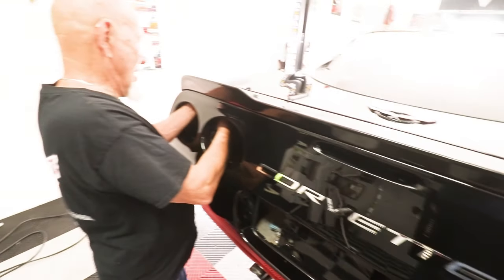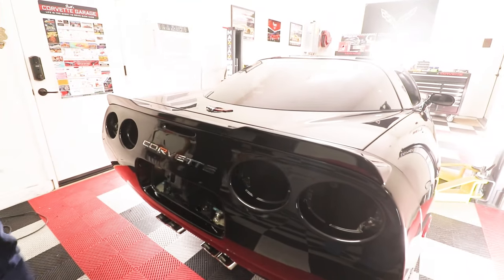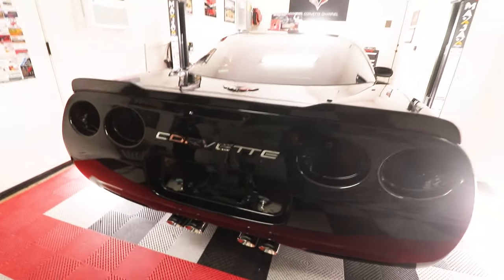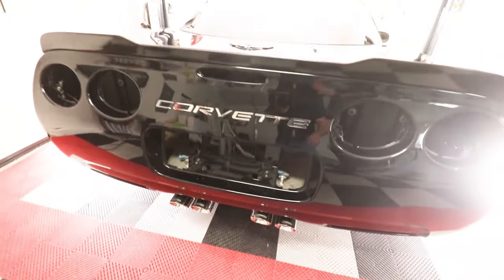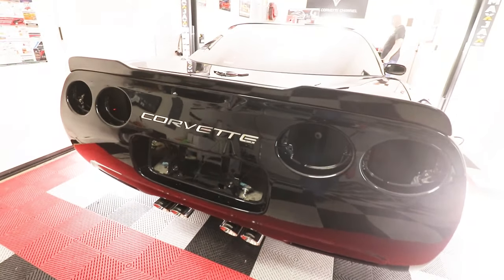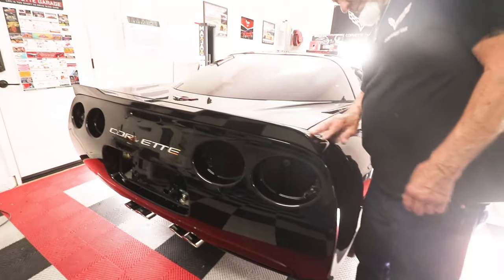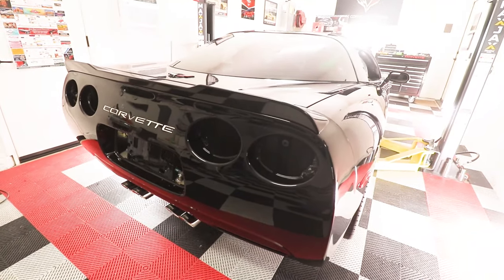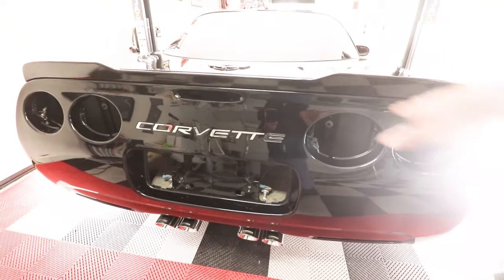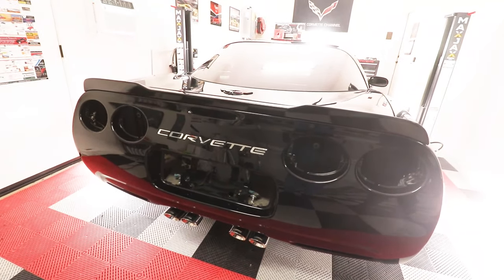Terry's just about done tightening that up and that is pretty much it for the spoiler. Literally all you're doing - the reason that bottom piece was out is because I had just done a ceramic coating on this car. It's a silver package with a five-year warranty. You don't actually have to pull the bottom piece, just the four tail lights and the center third brake light. So the next thing we're going to do is put the front splitter on the car, and then we'll do the side skirts.